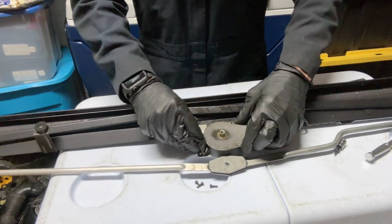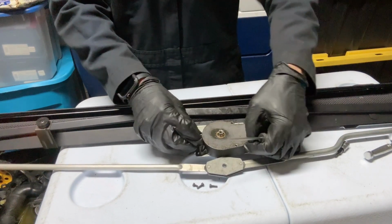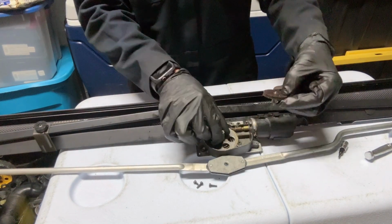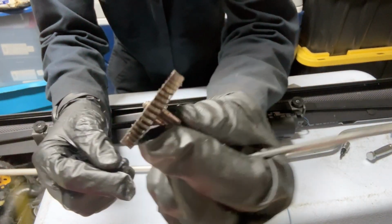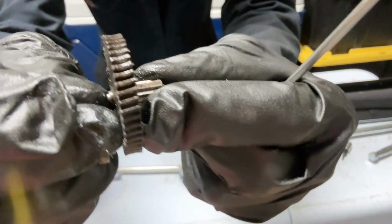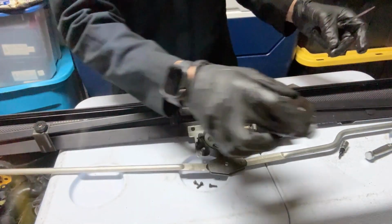All right, so you pop this cover off, maybe with a pick tool to help you out. You see? There's the spring. Oh, I almost hurt myself. But yeah, spring unwinding. You have this. This is what a lot of people get replacements of, because the worm gear usually, look, you can see there's a curve in. Luckily this one still works, but usually it's way more divoted in, and it will not work after a while. It would just make noise. And then you have a little axle through it. You want to keep that in there.